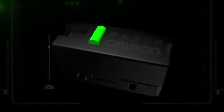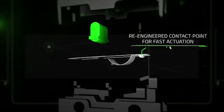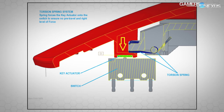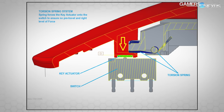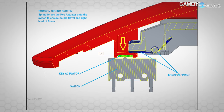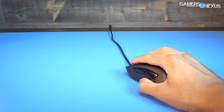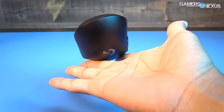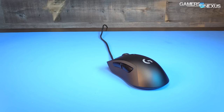The Death Adder, for instance, has a key plate that can flex under load because the key plate itself is acting as the deformable element, receiving all of your force. Logitech is moving that deformation to an internal plastic fulcrum, which helps keep the force fairly linear across the key plate and reduces accidental clicks. Though with the small mouse, the hand positioning pushes your fingers farther forward on the mouse one and two surface, which can lead to accidental clicks anyway.